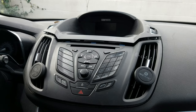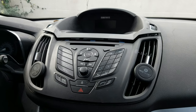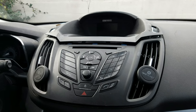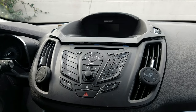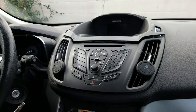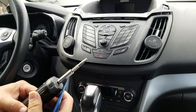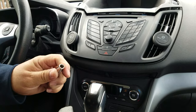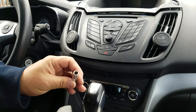I'm going to show you how to remove the radio CD player and display from a Ford C-Max 2013, which is similar to some other years. The tools you need are this blue dashboard removal tool, a size T25 Torx, and a 7mm socket.